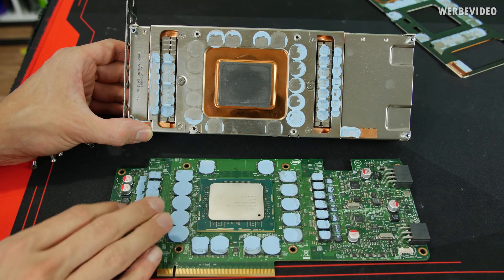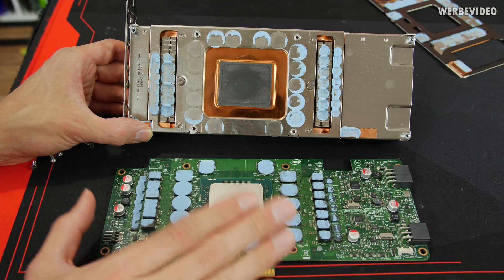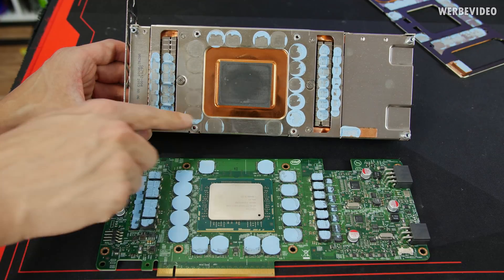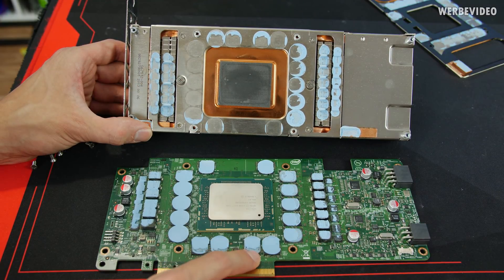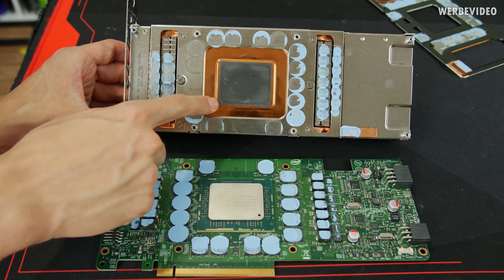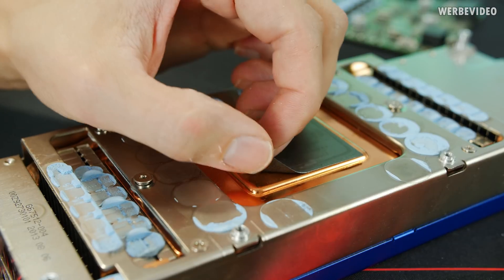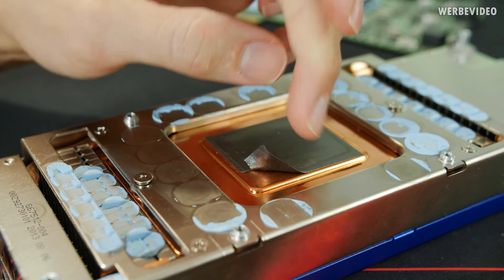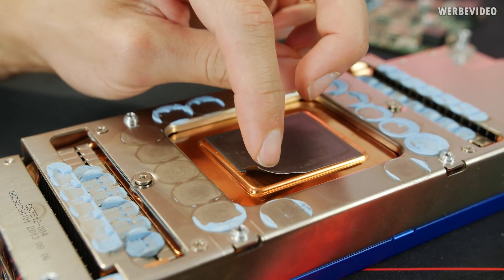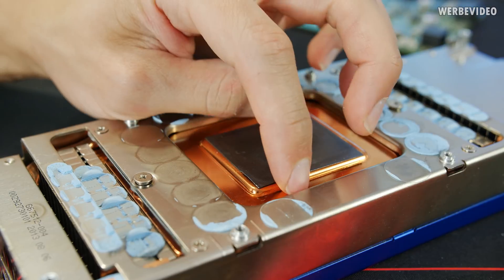Here we have the Xeon Phi with the cooler removed - a lot of residue from the thermal pad and thermal paste mix, which we'll remove in a second. The cooler itself is just a massive cover making contact with the memory ICs, then contact to the inductors and power stages. There's an interesting-looking thermal pad in the center, also a vapor chamber in the center, and this graphite sheet kind of reminds me of the latest generation of AMD cards where we saw something similar. It feels quite thick - maybe 0.2 to 0.3 mm - so thermal paste would perform better for sure.